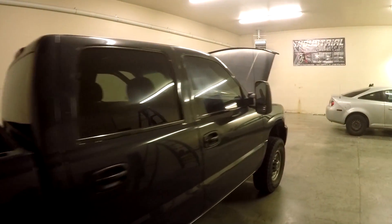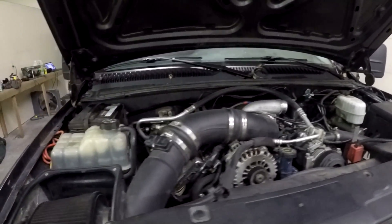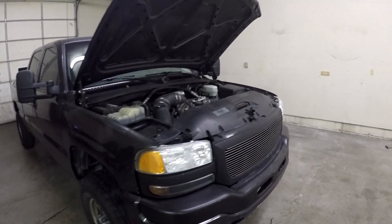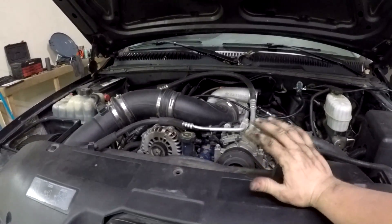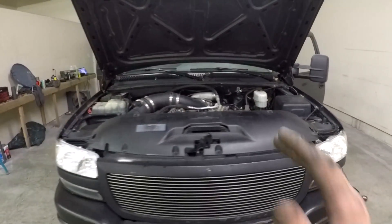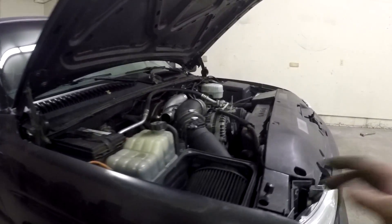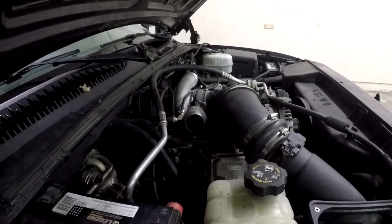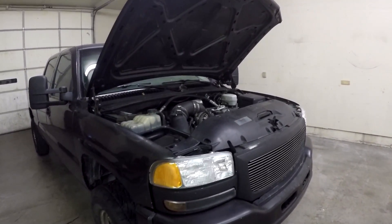The motor needs to come out, but I'm going to put 400,000 miles on this motor before I pull it — I need to put 9,000 more miles on it to do so. Once we hit that 400k mark, this motor will come out and I'll be putting in another motor I've already put together — pretty much stock again. This truck makes 690 wheel horsepower and it doesn't surprise me that the motor is on its way out; it's been at this power level for about the last 80,000 miles. Duramax bottom ends are really a gamble at anything over about 650 to 700 horse at the tire.